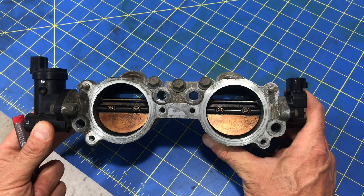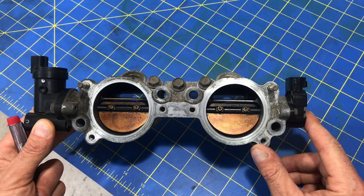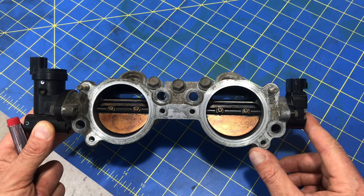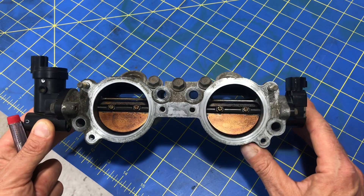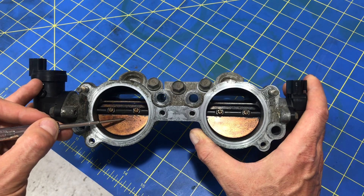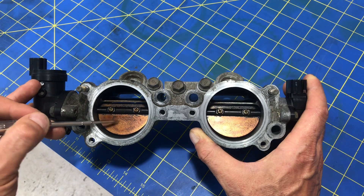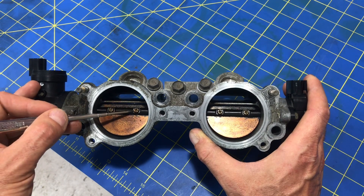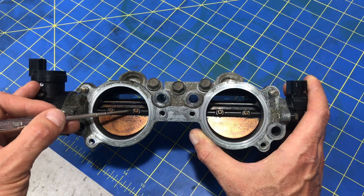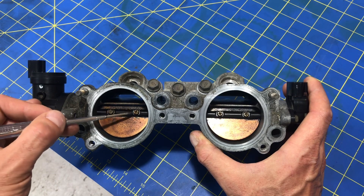Here's a close-up view of one of these TGVs. As you can see, the valves are pretty much in the closed position — that's how they are when the engine is cold. When the engine's fully warmed, these butterfly valves lift straight up and air passes through with minimal obstruction. Now if you're going to remove these butterfly valves, the first thing you might think is just remove the Phillips screw. The problem is that even after soaking with penetrating fluid, every time I've tried to remove one of these screws they end up stripping because they're softer metal and really tight in there.